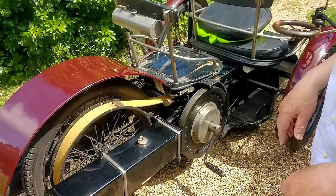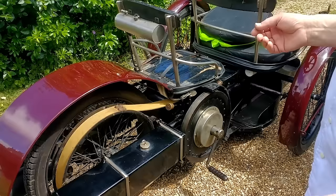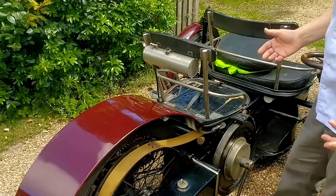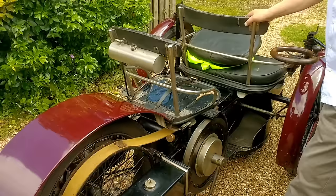So if you're idling, you make it easy for the brake to occur in the line, so you can idle at low revs. And then conversely, you can wind up a spring with this item here and get revs that are appropriate for going along the road. What sort of revs would it be normally running at when it's running at 20 miles an hour? Probably approaching 900 RPM. But it's very intermittent.